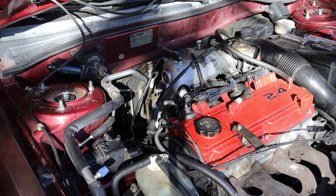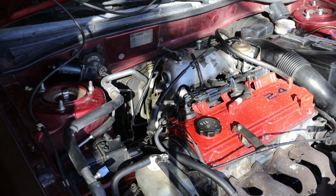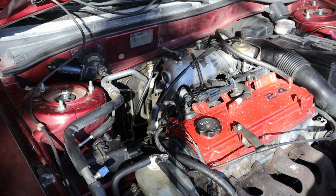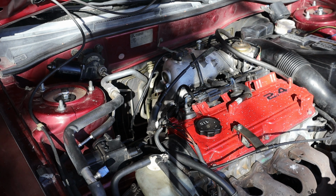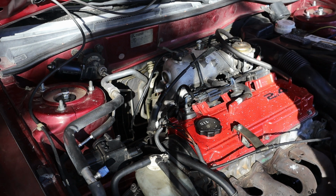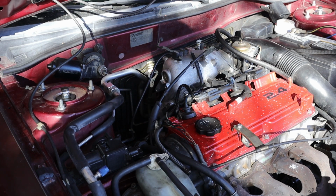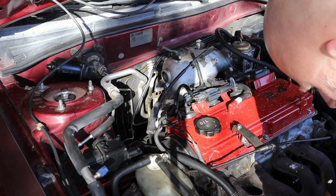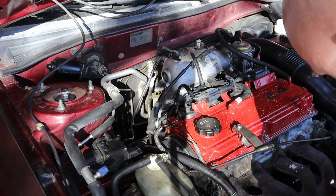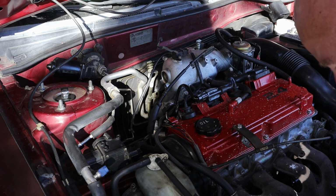The clutch isn't engaging, so it's either that wire. Let me take a look at it. Hang on. No, you can leave it running. It's either that wire or the AC might just be empty. It might just be low on coolant, not letting it run. Either we got to make that splice down here, because like I said, the wiring harness that I got from the pickup part has a connector on it, whereas the one on the AC does not. It may just be empty too.